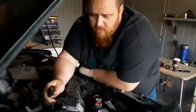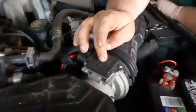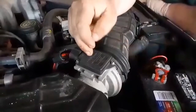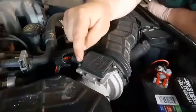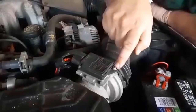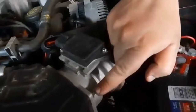In order to make this run right, just to get it here and make it to where I could actually get it to inspection and everything, I had to unplug this connector right here — this is the mass airflow sensor connector. Basically this is the mass airflow sensor, and this is the housing for it. You can buy them separately, but you can buy a reman with the housing and everything connected together. It's much easier to take apart because of these security screws right here — I have those, but not everybody will — that's why I did it this way, so we could just get on these little bolts and take it off very easily.